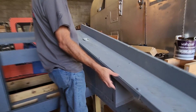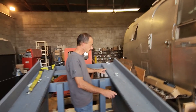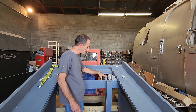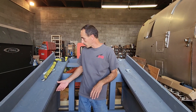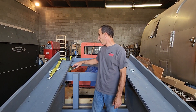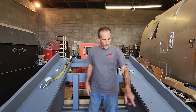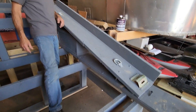You'll see a piece of angle here and a piece of angle down at the bottom. The purpose of this angle iron is because this top cantileveres over — from here forward is the cab of the truck, so from here up is a cantilever. To add support and rigidity, both sides have angle that goes all the way back, so when the tire sits up here it adds support. We also have angle on both sides at the rear where the rear tire sits, because you have a cantilever there as well.